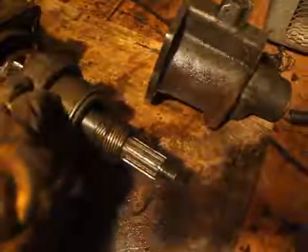The speedometer would go there, right? Now, the reason you try not to remove this big gear here is so that the cylindrical bearings there wouldn't fall off. In my case, some of them have already fallen off. I don't care because I'm going to have to clean them anyway, so they're probably all going to come off. But if you've got a new transmission and you don't want these things to come off, then you try to leave that big gear there inside, and just remove the housing.